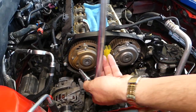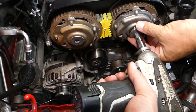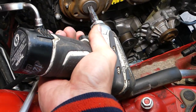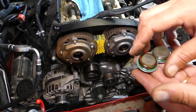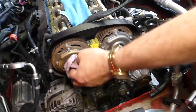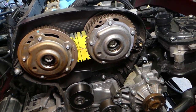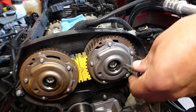Get the little impact and remove the bolts. There is a cap here with an oil seal — it's very important to clean up any oil mess so it doesn't contaminate the belt later. Inside there is another Torx — these are oil-filled cam gears. Let's see if it's the same Torx 55 tool.